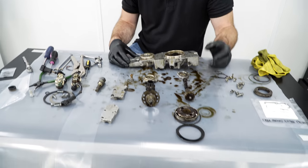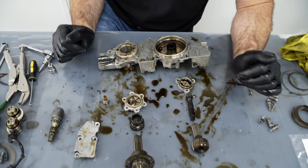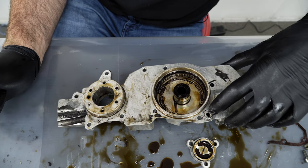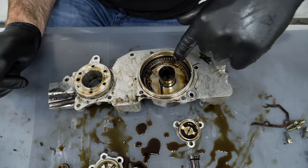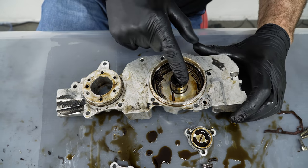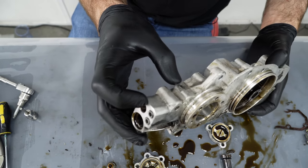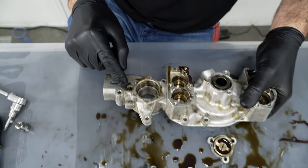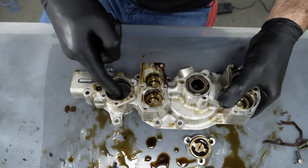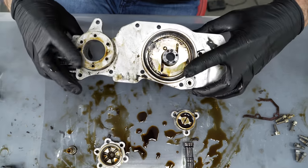So we've got all the bits laid out there. Inlet and exhaust side. And as you said, oil comes in from the one on the right, through a passageway into there, generated through the oil pump, which generates its own pressure, which then fires it through the unit to the pressure valve. You can see all the drillings where they've put the holes in, through the filter, through some more holes into the inlet piston. It then gets fed through the back to the exhaust piston, into the solenoids, which then obviously control the gears going in and out.